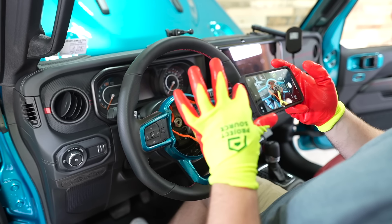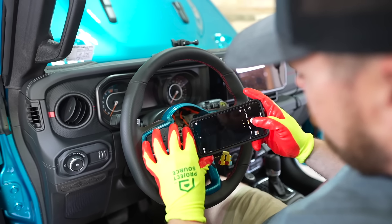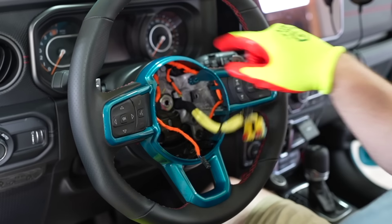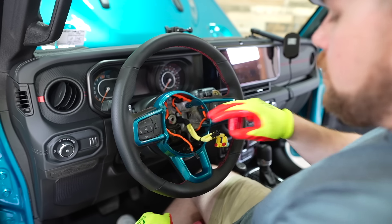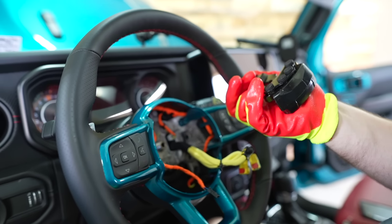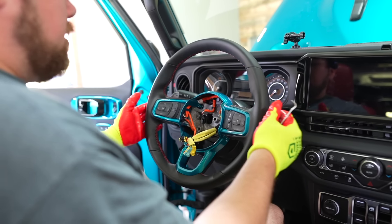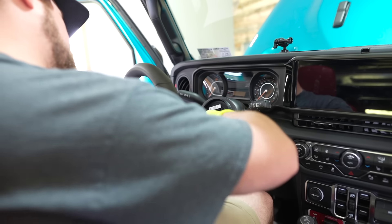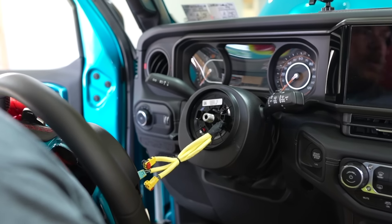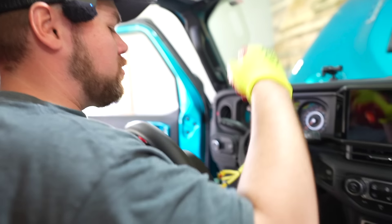One thing I like to do is take photos while I'm doing this because it really does help when you're reinstalling. So I've got the airbag disconnected. There's a large size socket in the middle that you need to remove. And if you guys recall us doing this trim, we had to remove the wheel weight — there's actually a wheel weight on here, and it's got a little bit of weight to it. We got both of those disconnected; they go on either side of your clock spring. Then you can just pull the wheel out towards you — and be careful, don't turn your clock spring too much. On one of my old Jeeps, I had the shaft disconnected and went in and spun the wheel, and the clock spring shredded and nothing in the steering wheel worked.